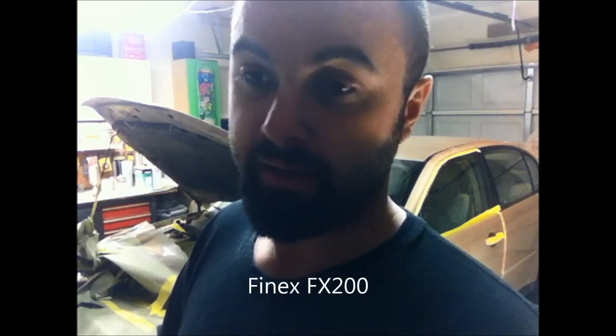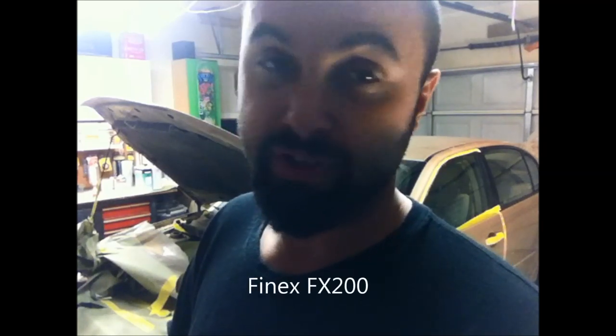I don't know if you guys noticed in the videos, but it'd only take about one pass and the compressor would kick on. After about the third pass, I was down to 40 pounds or under. And this gun doesn't spray a good paint job at 40 pounds. It sprays a good paint job at 65, 70 pounds. So the result of that was a crap load of orange peel. It's just really fuzzy in a bunch of areas and a whole bunch of orange peel.